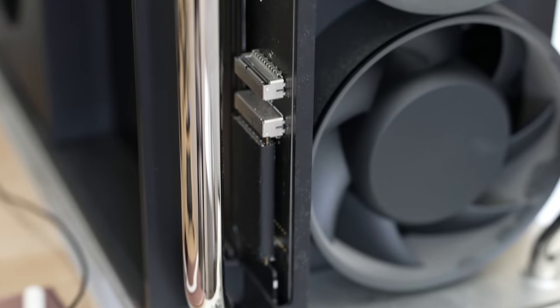We got these off — I can't believe how much had to come apart. This top plate is literally screwed into the chip or motherboard. Oh wow — oh there you go. The M1 Ultra is literally cooled to this whole thing. There are heat pipes going to this whole block, and this back side is literally cooling just the back part of the chip to get it even cooler. That's dual-sided cooling — and look at that beauty right there, hidden and well protected.